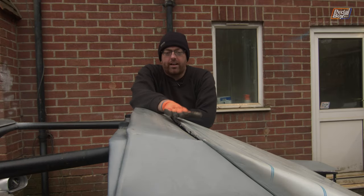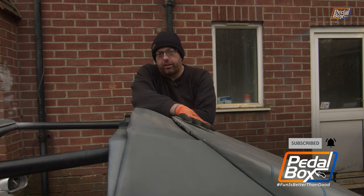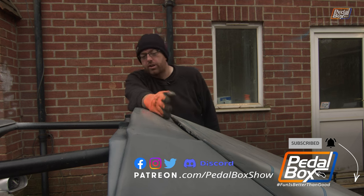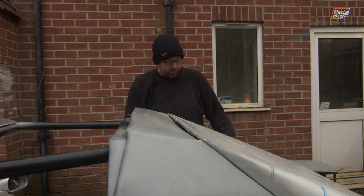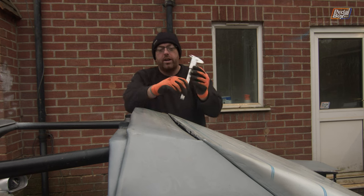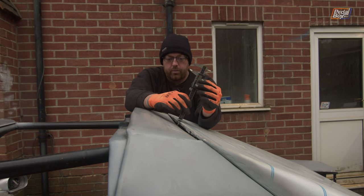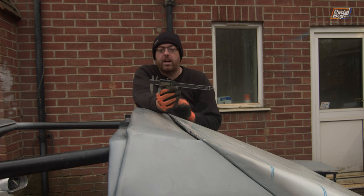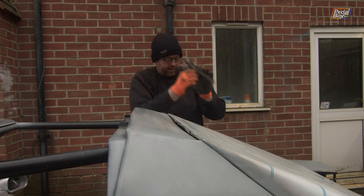It's about time we tackle the problem with the roofline where it joins into the engine cover. We need to close up this gap so we don't get weather going straight down and sitting on top of the engine. Using a vernier, it's just under 20mm — 19mm and change — from the top edge all the way down into the deepest point in the centre.